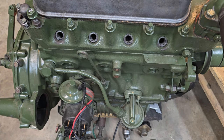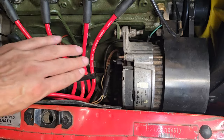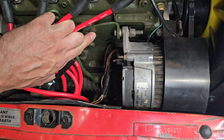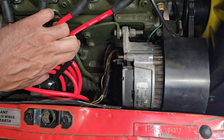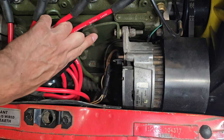I'll show you on my red Mini — it's got an alternator, but it still uses the generator attachment plates. This is the style mount to use an alternator on an A-series motor, and this is an A-127 alternator mounted to an A-series motor.